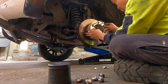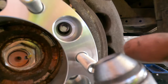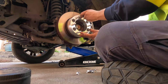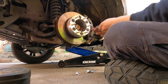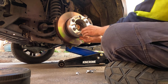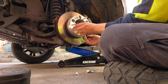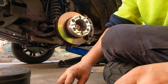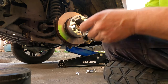So all about the tire specialist, see that little groove inside here? That groove goes in there and you tighten up slowly. So you do that on all six before you use the rattle gun. Make sure they're all in line. Diagonal it. It should be very strong. I have no trouble with my Mercedes. It worked very well on my car, so it's all right. All by hand, make sure they're in line and then you can use the rattle gun later, okay? All have to be tightened because you try to get all the grooves on. And then you can do whatever you want, man. All yours, okay? I get excited, man.